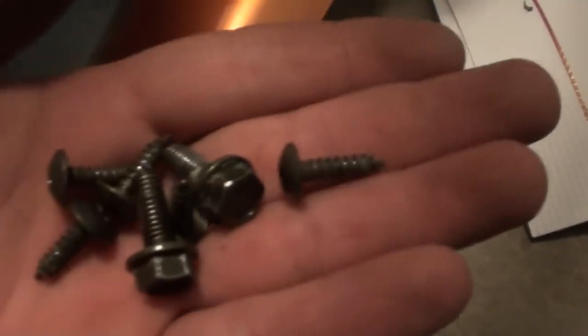Trying to remove the bottom shield of the dash, I found out that the actual side rocker panel on the bottom has to come off first. You have two 10-millimeter bolts, and then in three locations under the mat you have phillips head screws that have to come out. You also have two phillips head screws — one here, and one up here on the other side. They have to come out. That's where the 10-millimeter sockets are, and there's where the screws are.